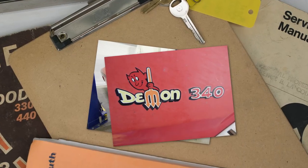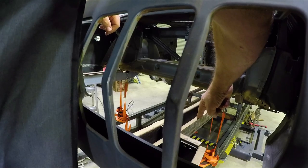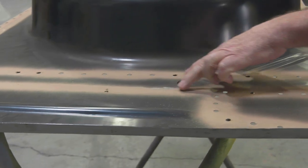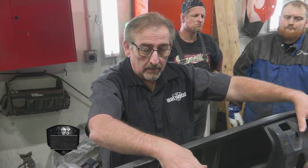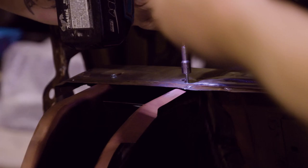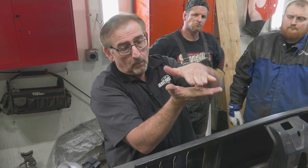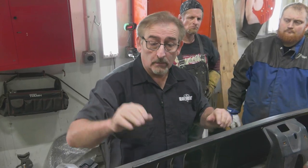One of the really neat cars in the shop is our '71 Demon — a 340 4-speed, one of the really rare and well-documented Mr. Norms cars. The holes in the floor marry up against the flange of the frame rail on both sides. That pattern matches this frame rail footprint as well as this perch holder and the leaf spring hanger area. They'll put the floor into place, mock it, clamp it, and make sure it's where it's supposed to be. Then they're going to use self-tapping screws in between the welds to marry the two panels together. You don't want a gap and then fill it with plug weld, so they'll suck those two panels together with self-tapping screws, weld it up, and then we're ready to move on to the trunk floor extensions.